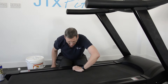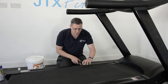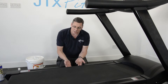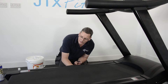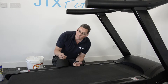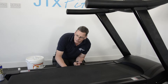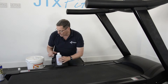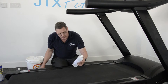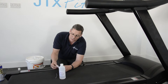If you can't get it open with your fingers, just insert a little screwdriver, get the edge up and pop it under for good access. Feel under there — you should feel the residue of the oil. It should feel slippy and kind of greasy under your fingers. If it is, then it's just a case of topping it up. For example, you could use this kit here — a 500ml bottle of lube that comes with a syringe.